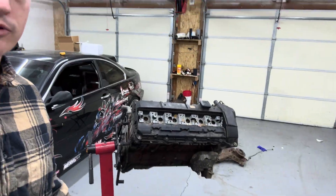We've been running M54s in this car for five years now. I've gone through quite a few failures — oil pump failures, spinning bearings, had one head gasket failure, never had any ring land issues, but still had some failures around the 400 to 450 horsepower mark. We want to turn it up, have some reliability, and making 500 without having to worry about it would be pretty sweet.